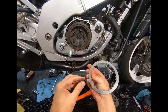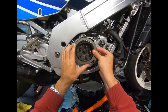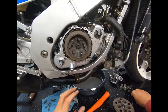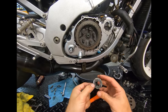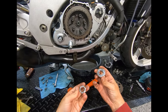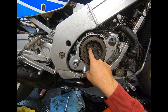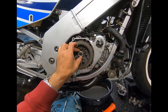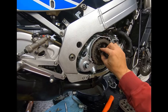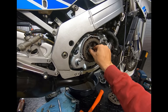That's the last steel plate - definitely sharp out, that's the way it went. I've done a little damage to this locking washer but it wouldn't hurt to use it again. You just want to make sure you don't bend that same edge up more than once, because it could get a stress fracture and break, which would mean it was no longer holding that nut in place.